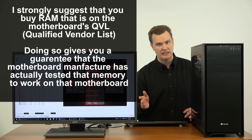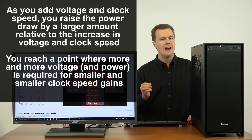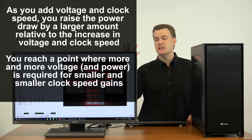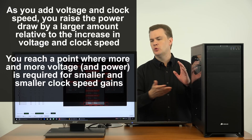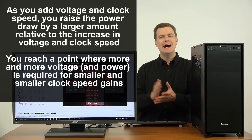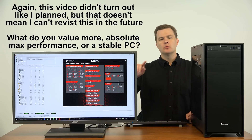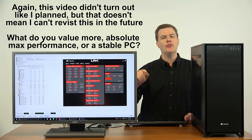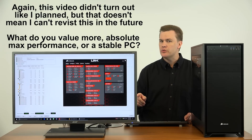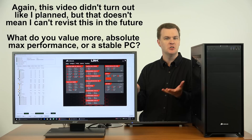The motherboard auto-sets the voltage higher, and I have played around with this as well — I've raised it and lowered it. What I've discovered is that while 1.3 volts uses a little more power and makes a little more heat than 1.22 or 1.25, it's not much. But it gives you a more stable system — a larger margin for stability — and with this level of cooling, heat is simply not an issue. I am more interested in an absolutely stable system. I'm going to reboot the machine, show you the BIOS settings, then talk about all the other things I did for six hours and why I don't think you should do them.